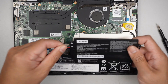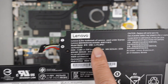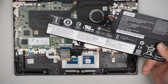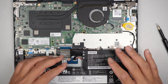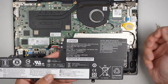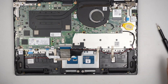There are five screws in total holding down the battery. To find a replacement battery, look for the model number L17L3P61. If you feel like the clicker is not clickable or there's a lump on the back of your laptop, it's most likely the battery — when the battery is overcharged or you always leave the charger plugged in, the battery can swell.